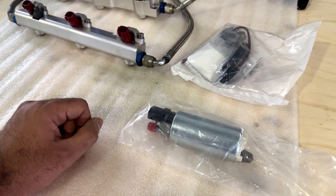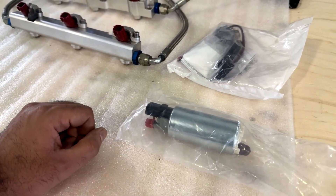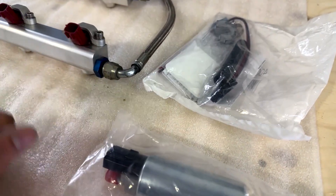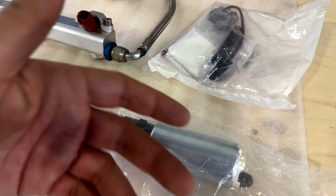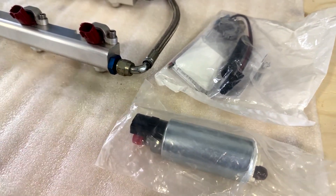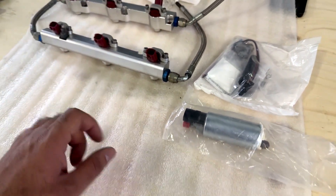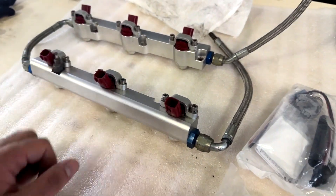My car is probably not going to reach that anytime soon — I'm aiming for 400 horsepower, so this is more than sufficient. If you have a twin turbo fuel pump you obviously don't need to do something like this. The stock twin turbo fuel pump will probably handle more power than even the Walbro 255. I'm doing it because I have the OEM NA fuel pump. So that's what's going in the car today.